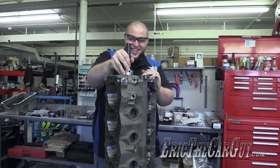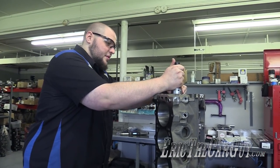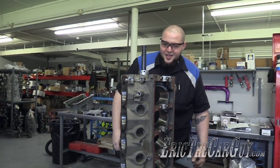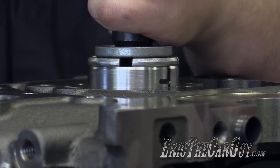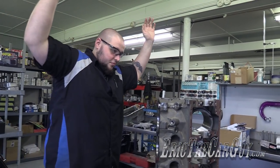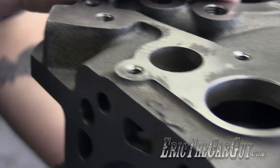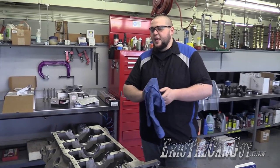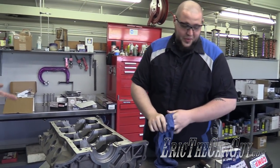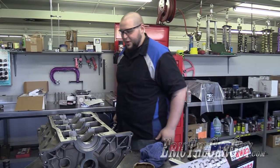I don't think people at home are going to be doing this — it's just so they can see the process. If you've got $600 burning a hole in your wallet and really want to do cam bearings, there you go. To make sure the cam fits, usually throw in the two rear cam bearings, test the cam, throw in another bearing, test the cam, throw in another bearing, test the cam — because it's better to find out now. That way you can isolate which one is the issue. Sometimes you can get away with using just a bearing scraper if there's just a little bit of a burr.